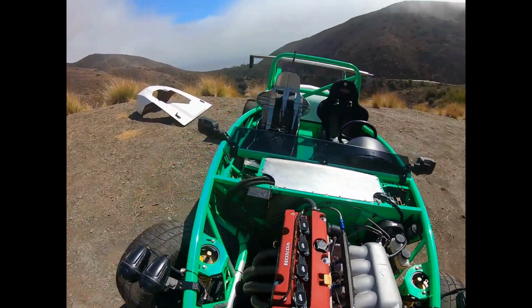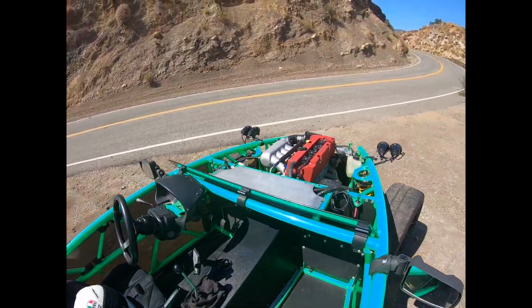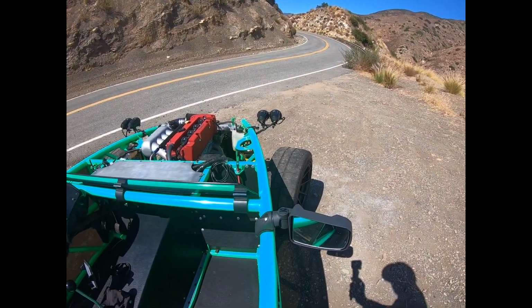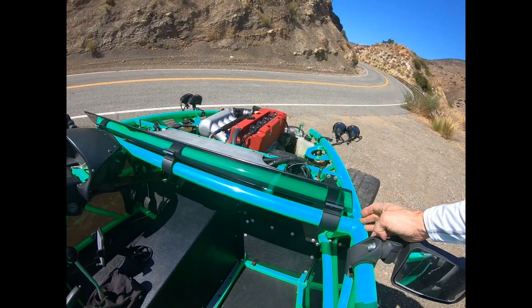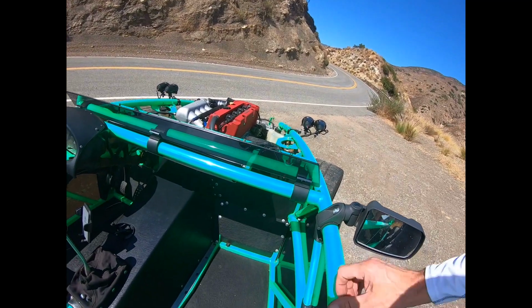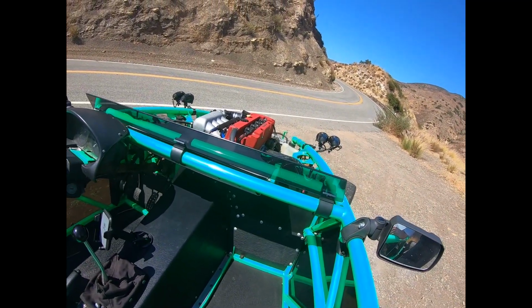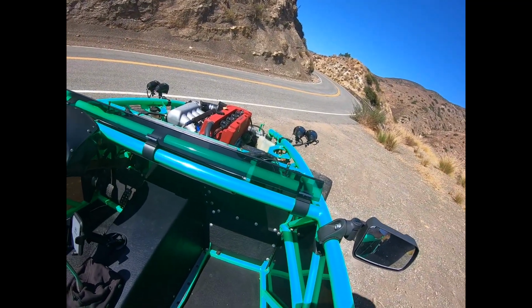Next thing, wind deflector. So I've got to give Russ Bergholtz, I think his name is, credit. I've been using for the first 5-6 years Aeromotive's windshield bracket, and it was kind of heavy and big, and Russ was saying you don't really need something that big, especially if you're going with only a 6-inch wind deflector, which is what I have and what I recommend. Remember, the cars had 12 and 15-inch windshields on it, but I like the 6-inch with a helmet.